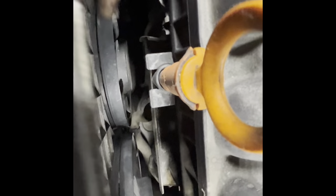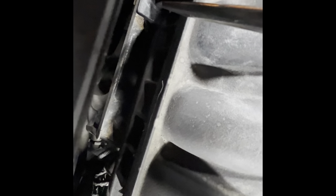Once that's clean, take this little clip here for the dipstick and push it downwards. Use a large screwdriver and bump it down, working both sides — these are kind of a fight. Just go back and forth and it'll fall down. Then lift the car up, because you have to do a few things from underneath.